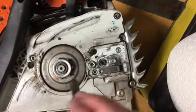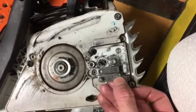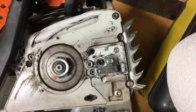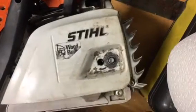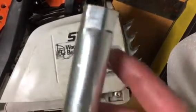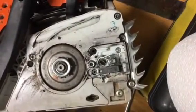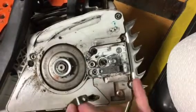But that pin breaks off somewhat easily, and there's a couple ways you can screw it up. I think I've broken this thing 3 times. There's a really dumb way to do it, and then there's the standard dumb way, which is my way. Basically, if you don't take this nut loose and you have it really tight, and then you try to tension up your chain, you're tensioning this slide against a bar that's stuck in place, then you'll break that pin off at the end of it. So I think that's the really dumb way, although any of us could do that probably.